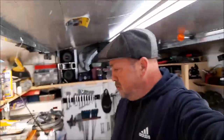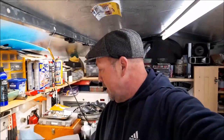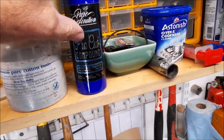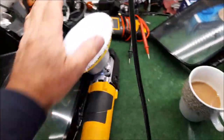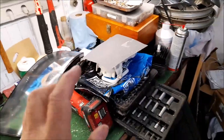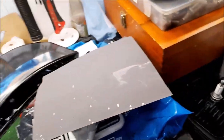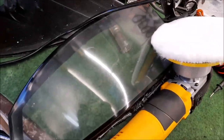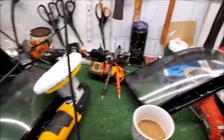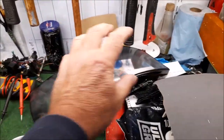Good morning — it's sunny but bloody cold in the shed. So where was I? Headlights. After the cutting compound on the sponge I've buffed them up. I did 600, 800, and 1200 grit — could really do with 1500, 2000, and 2500 to make them really shine. They're a bit dull but I'm going to reassemble these light fittings now and get them back on the car, because it'll be easier to buff them on the car.